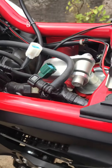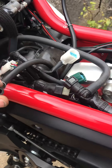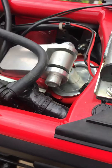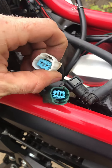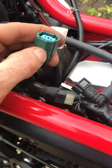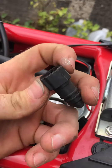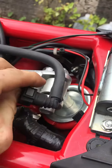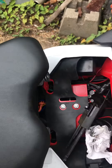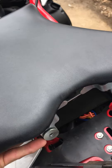You've got two sensors, the fuel itself, and two on each side. The rubber hose is easy enough. The sensors — you just push the button, push it in, pull it out. Same thing here: push it in, pull it out. For the fuel line, you push both sides in and then pull it out. Pretty easy.